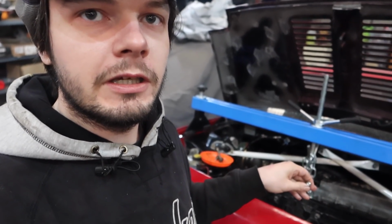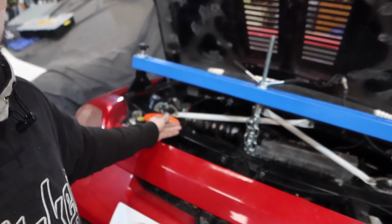It's really annoying. So obviously you saw me yesterday doing a helicoil on the half shaft bolts. I've had to do one already to this gearbox, which I didn't show you, which was actually on one of the engine mounts. And now I'm going to have to take the gearbox off again to do another helicoil on the slave cylinder bolts. Yeah, one of them's pulled the threads out, so the gearbox has got to come off again.